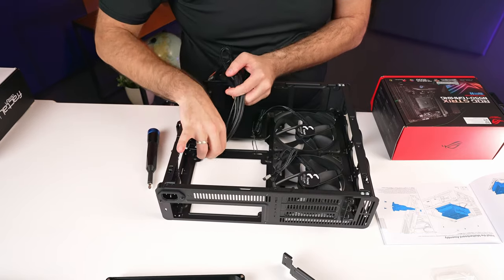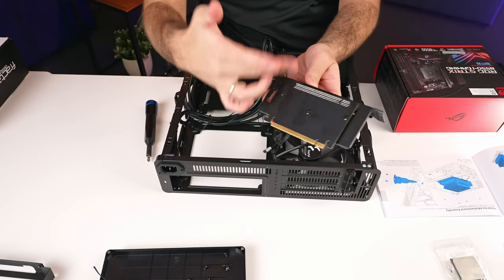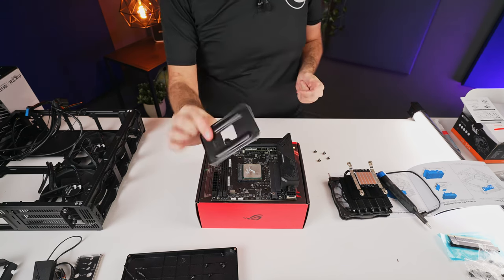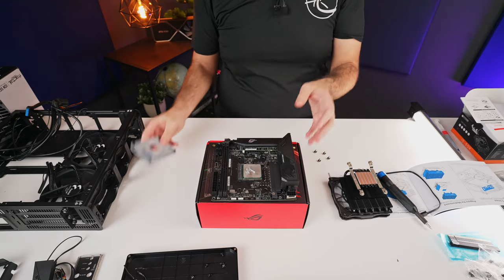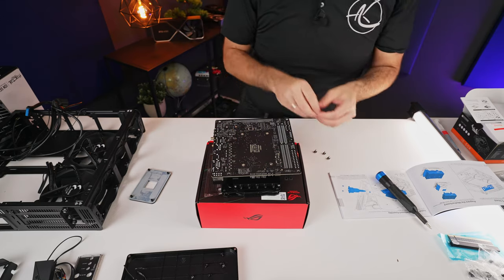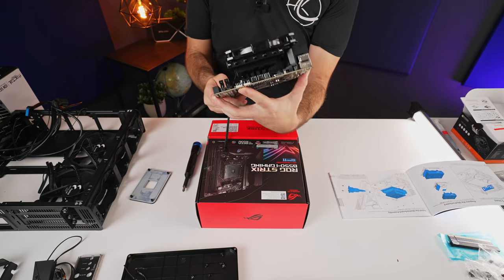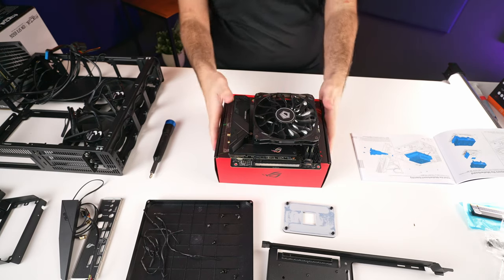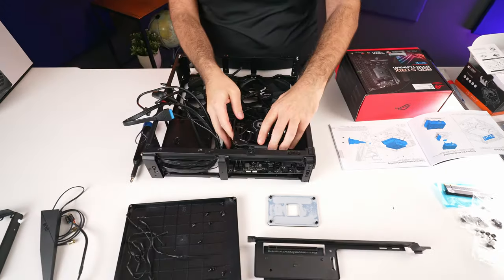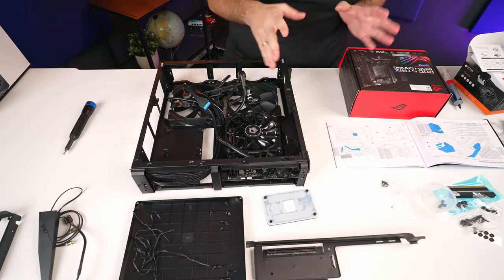There are a bunch of cable retention points so you can cable tie your cables, and there are a few more points here for PCIe cables. Installing the IS-50X cooler is a bit new for me — it doesn't use a separate backplate or existing AMD/Intel bracket. You literally just set up the cooler, flip the board over, and screw directly into it. That's looking good. Next step is to install this inside the case — start with the IO shield, click it in place, then slot in the motherboard and make sure all ports are aligned.